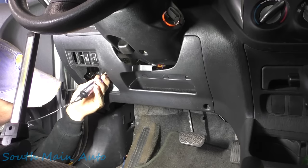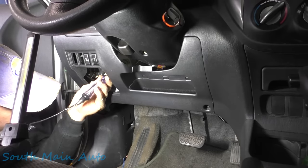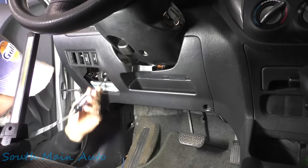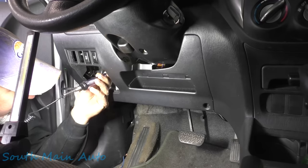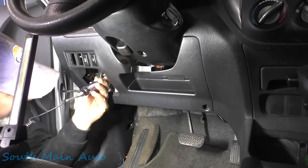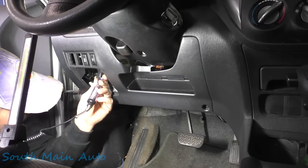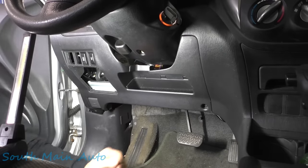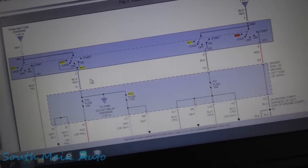Nothing there. I'm just going to check a few other fuses here. Either our test light is bad or all these fuses are dead. But no — our test light works; here's a hot something. Yes, none — all of these fuses appear to be DOA. All right, that's something good to know. Let's see where that power comes from and trace the problem backwards, and we've done this in no time. Here's our fuse inside — that's supposed to have power in the accessory and on position, and it doesn't.